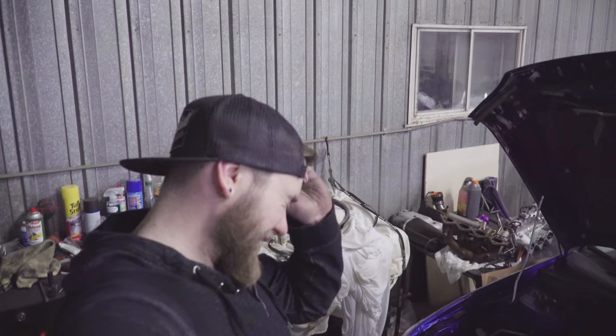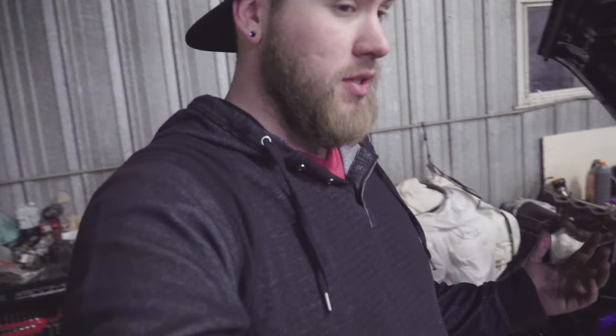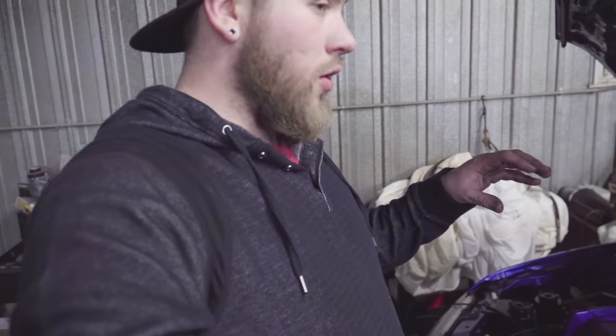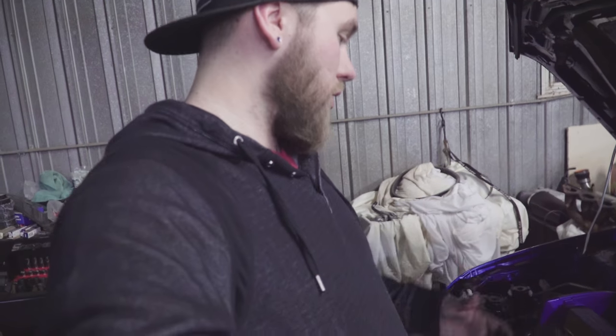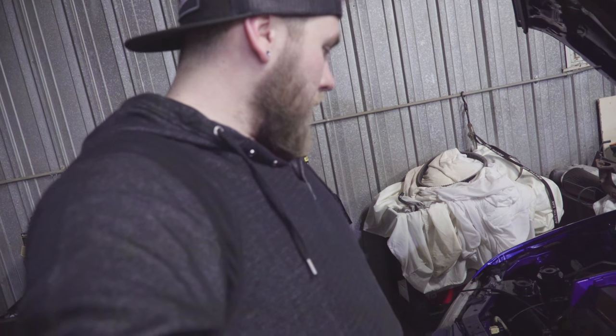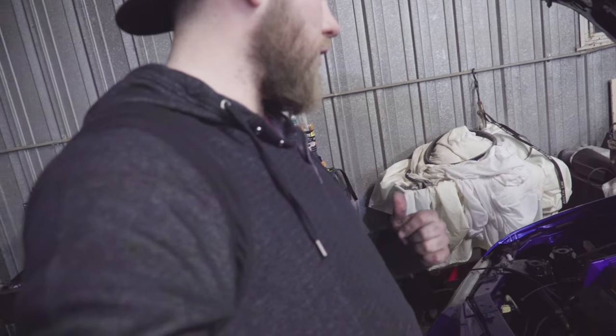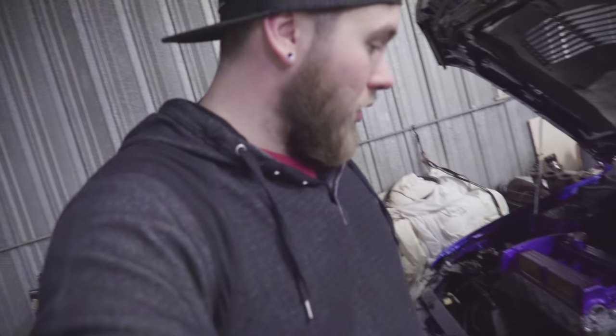But I'm just worried about that cylinder number 4, because I didn't even look. And the reason why I didn't is because when I pulled the head off, there was coolant sitting in that cylinder. Granted, I pulled the head off about a day after this happened, so it wasn't sitting in there contaminating the piston or the cylinder walls. So the rings still seal, I hope, because it had coolant in that cylinder. So I pushed the coolant out, obviously, and I'm just fingers crossed that the valves did not hit the pistons when I rotated it. I turned it over, I don't know, about 6-8 times.